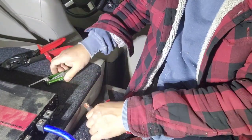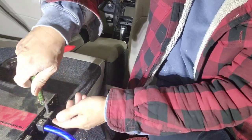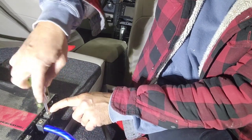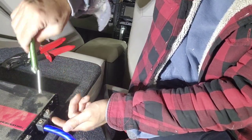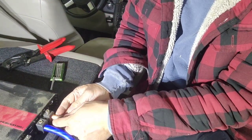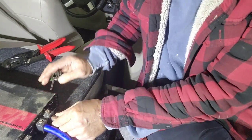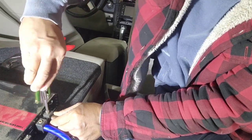Make sure to know why it's sticking out. And as I mentioned earlier about getting all this in, a lot of people didn't get this screw out all the way on top. And when they push a wire in, the copper will be sticking out. You don't want that. Push it in right there. Make sure nothing's sticking out. You can see ain't nothing sticking out.